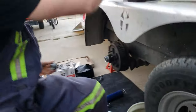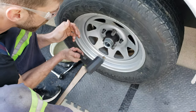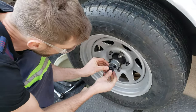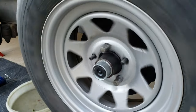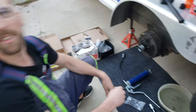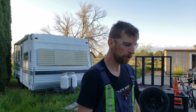The last step is the cover — the cap — and the rubber seal that goes on that. This is the seal you take off when you want to do maintenance and just grease it with a grease gun. Bam, bam. And of course we're waiting on new wheels, though we could just rotate those tires for now until the new ones show up if we want to use the trailer right away. Anyway guys, my name is Marcel Ernie — I just learned how to do this last week and did my own research. So don't take my word for any of this, but that's what I learned. Hope you enjoy the show.